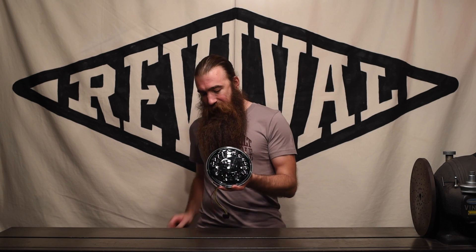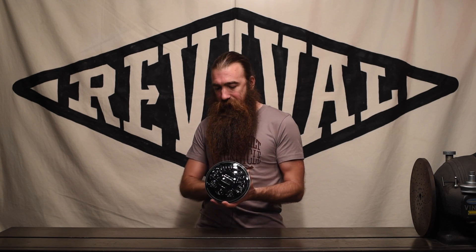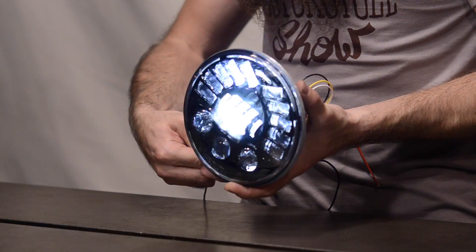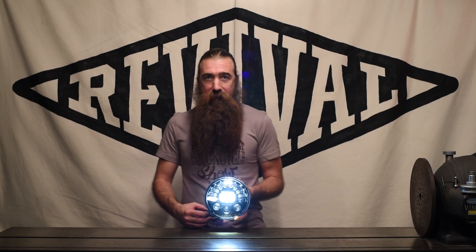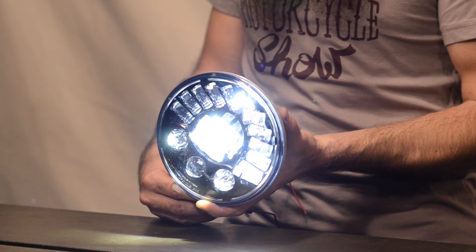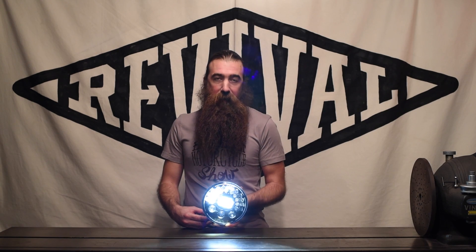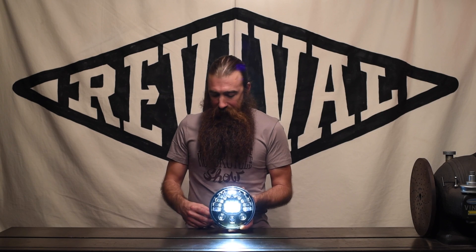So what does it look like? Is this thing actually as cool as it sounds? Let's power it up — starting with a ground wire, connect that to black, and a power wire connected to just the low beam for now. You may have seen all those adaptive lights dancing around in there — that's just how it's orienting itself, calibrating so that it knows which way is up. If I roll this light, you can see that some of the side lights will start to actually illuminate, and that's what the adaptive process is doing. As you go into a corner, it's going to change the light patterns to match your bank angle to make sure you can see as much of the road as possible. So that's the low beam.